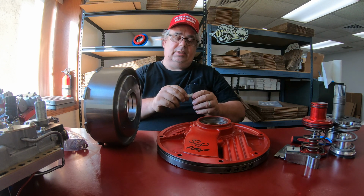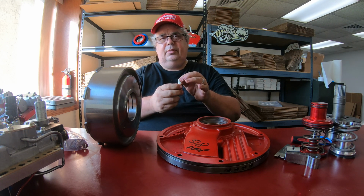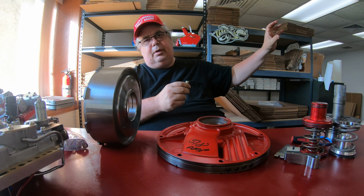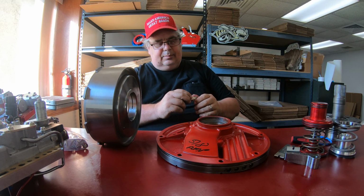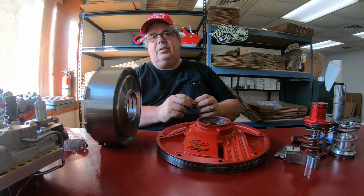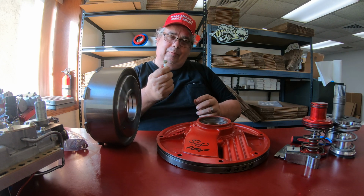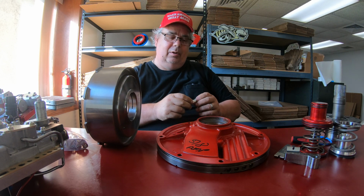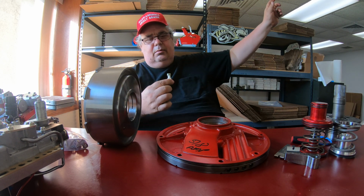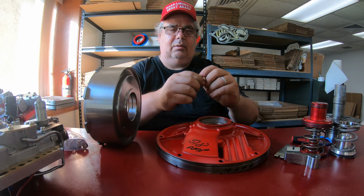But if you're going to get a vent, I recommend that you take the cap off and you run a line up to the master cylinder and put a puke can up there. Because one in every, I don't know, 9 or 10 transmissions, you got one that'll puke and puke and puke, and there's no reason for it. You got a puker. But if you put the catch can up higher than this, it'll burp a little bit and then just drain right back in there.